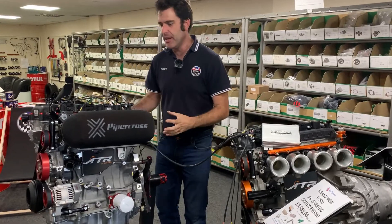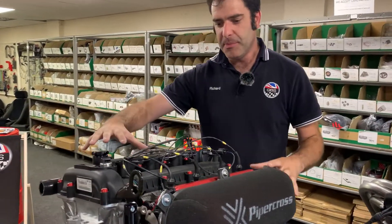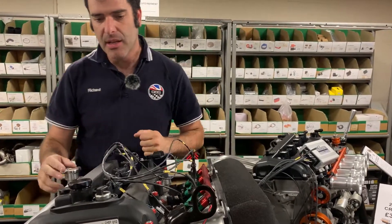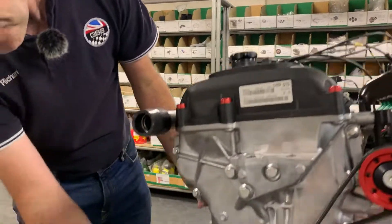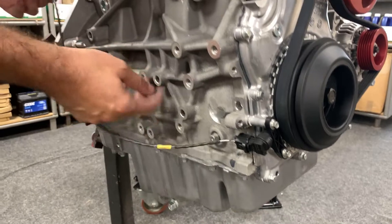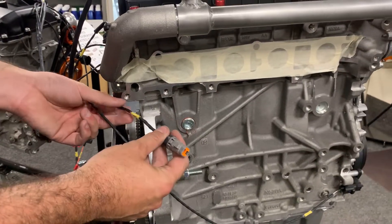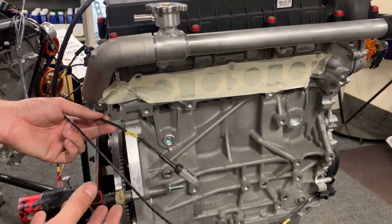We'll look at the engine loom on the engine and some of the sensors, coil packs and injectors. I've just laid it on so we can see for the video — typically we'd hide a lot of the wiring underneath and bring them up so it looks a lot cleaner. On the loom, first of all you've got your crank sensor, using the original crank sensor that comes on the engine with shielded cable. On this side we also have our lambda sensor — standard four-wire narrow band lambda, though you can add a wide band if you need it. Then we have our coolant temp sensor for the ECU; for your instrument gauge you'd use your existing one in the vehicle.